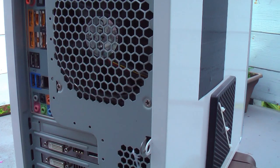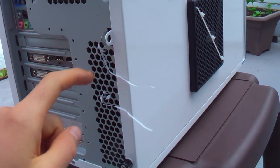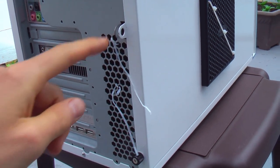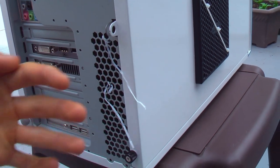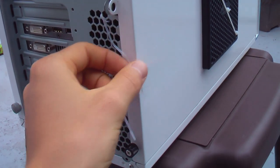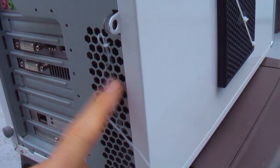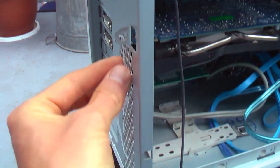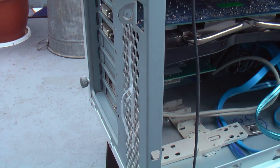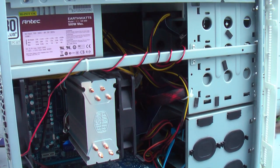What we'll be doing is determining the pressure of the air inside the case. If it's under positive pressure, that's a good thing — it means that air will be flowing out of any open vents. If you have a vacuum inside your case, unfiltered air will flow inwards, which isn't what you want. To test whether you have compression or a vacuum, just tie some little plastic streamers onto an open vent. If you have positive air pressure, these will stick out when your computer runs. But if they're getting sucked towards or into the vent, you have a slight vacuum in your case.